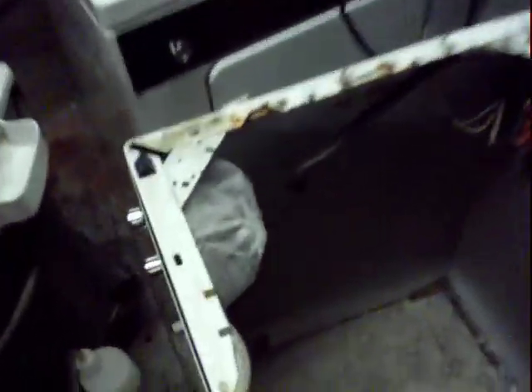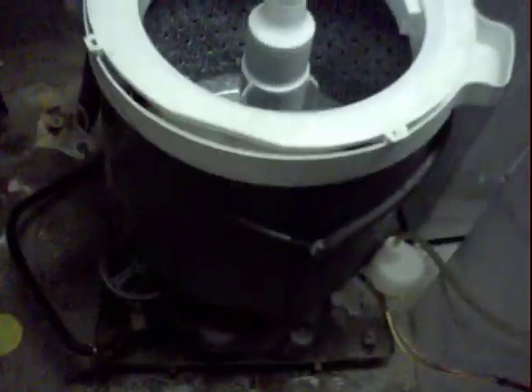I'm used to Hoovers and some really old stuff that don't have connectors - they just have single spade connector wires. The inlet valve you just undo there, and it's actually part of the harness. The only thing you have to undo is take the top off, unscrew a couple of ground cords. These little clips here are just cabinet clips - the perfect size for a spade connector. This is the lid switch; you have to be careful that it doesn't touch metal.